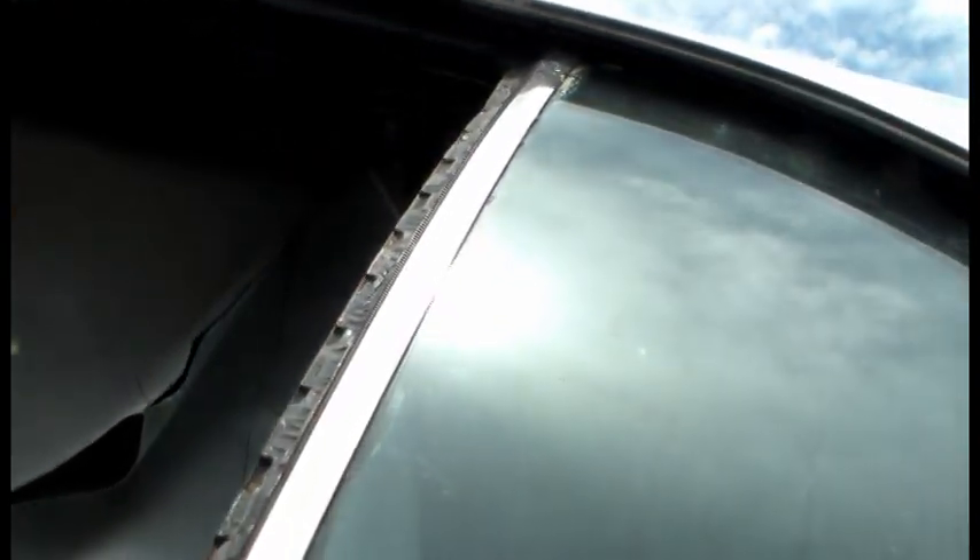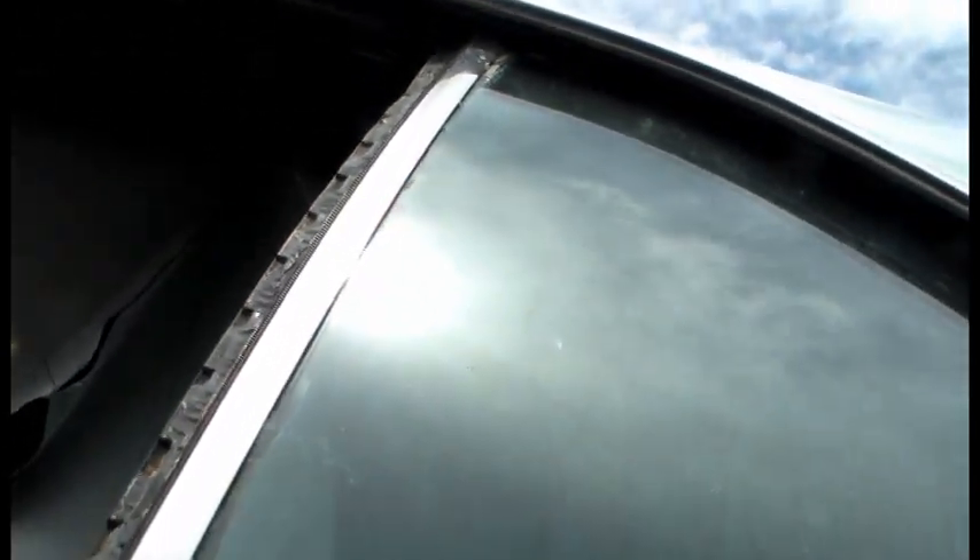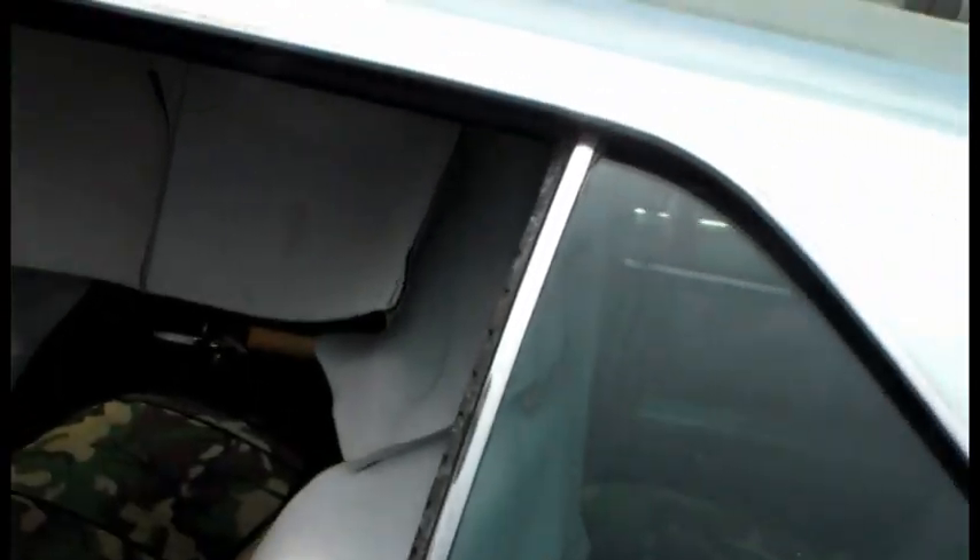I know a little something about this. I put a sunroof in my car — electric, retilting the sunroof — so I had to remove the whole inner shell first before making the cut outside the roof. Because for a retractable roof, the three-stage one that goes vents up, wraps and retracts inside of the car — you got to take all that out. And I was able to do it with regular headliner material, tack it in the front and pull it to the back and do it side to side using that yellow glue. Because if you use that regular 3M you buy out of the store, it's going to drop.